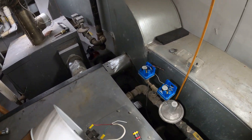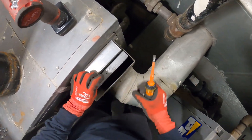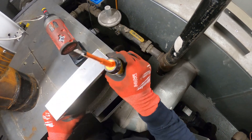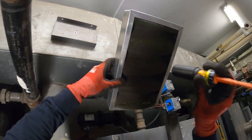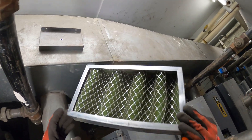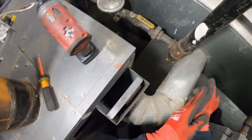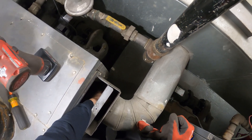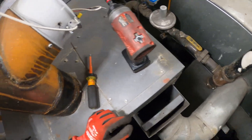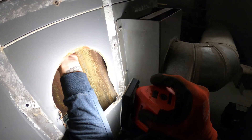This is our fresh air intake — air is coming in here, and this is our filter. For low airflow you always want to check your intake and outtake to make sure that's clear. Look at that — pretty dirty. This is a washable filter. But at the same time, I don't think that's really playing a role right now because we have that whole front cover open. I feel some cold air coming in, but with the front cover open it's not bringing in fresh air — it's taking in the air from in here.